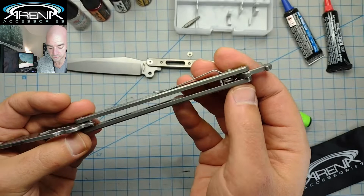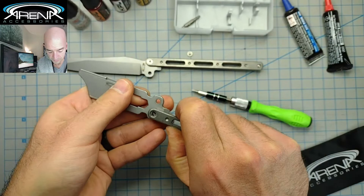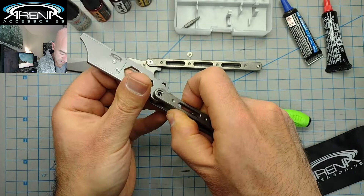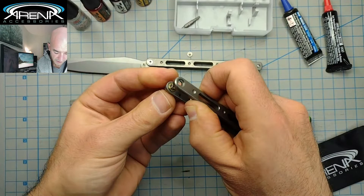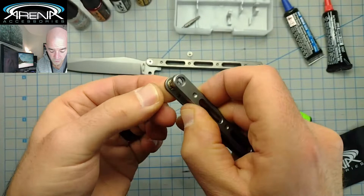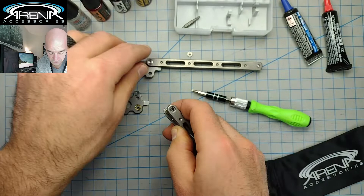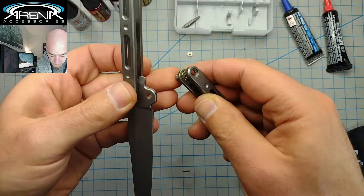Back to the actual tutorial — you can see how much space you have here. I'm going to lift up and just kind of spread this out, and there you go — it's disassembled. You still have the D channel. These screws are awesome because they've got a D shape to them. You can see that flat edge on the screw that stops one side of the pivot from ever spinning. Your washer is still installed underneath. You've got your bearing. Now we just need to install the other side of the blade.